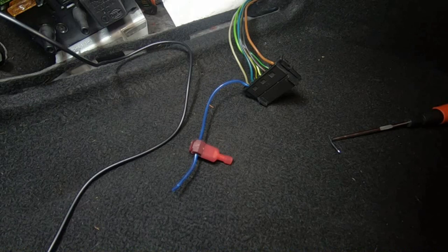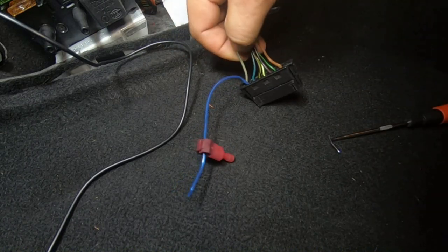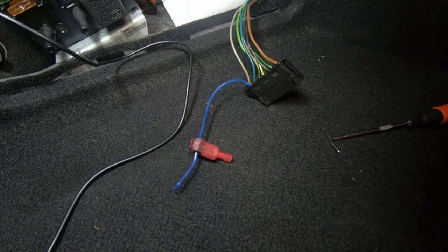When you plug this in, make sure that the blade does sit inside — sometimes the blade will sit on top, which is incorrect. Make sure the blade actually sits inside so it makes a secure connection. That's exactly how you would tap into your positive cable for your reverse light. Do not cut it. Never ever cut factory wires unless you absolutely have to, and if you do cut it, make sure you use a soldering connection.